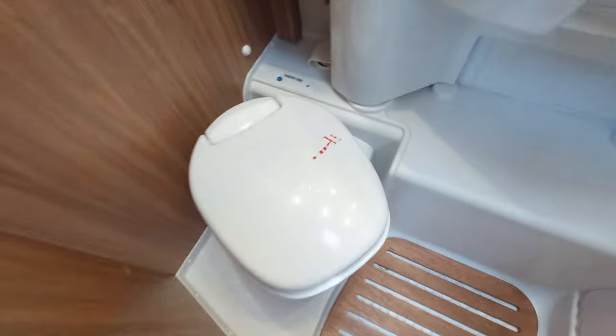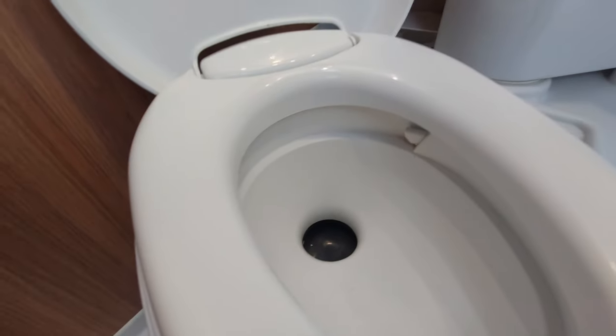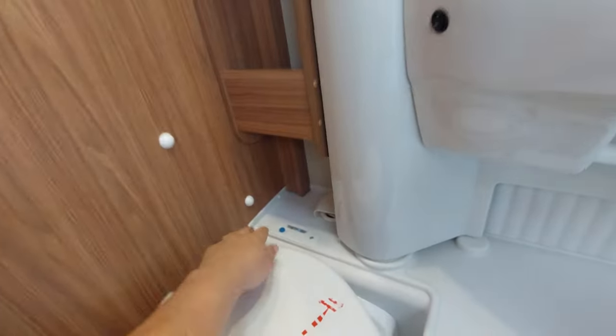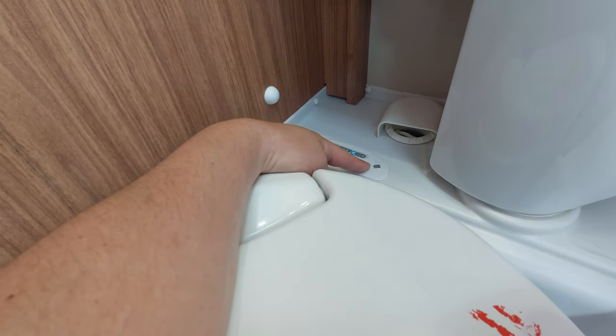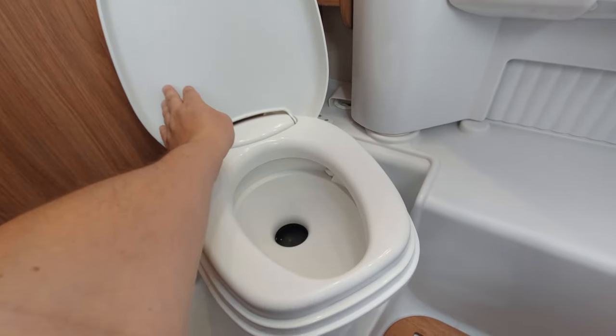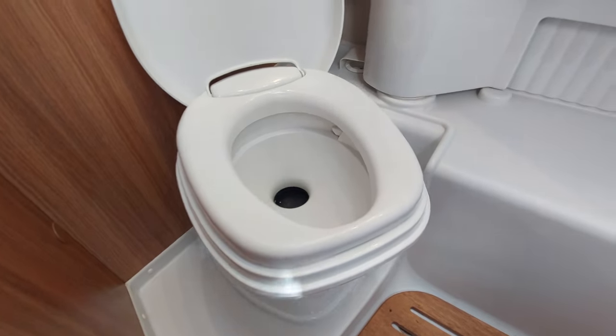In the bathroom, the toilet on this model will swivel — move it to the angle you need, open the lid, and operate this lever at the side which opens and closes the blade valve directly connected to the cassette. Open it, use the toilet, and press the flush button — the green/blue button. If the toilet cassette is full a warning light illuminates. That nozzle is the heating outlet. When travelling with waste in the cassette, make sure the blade is closed or the waste could spill into the motorhome.